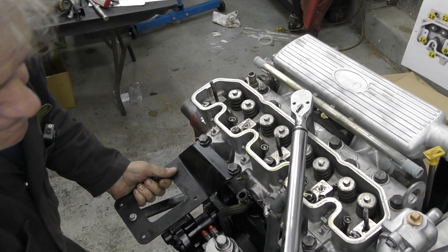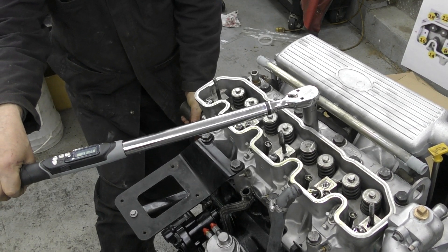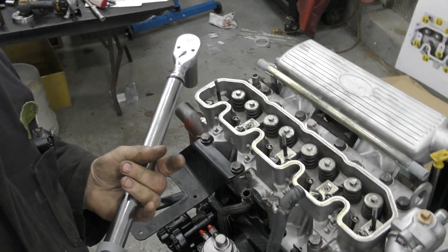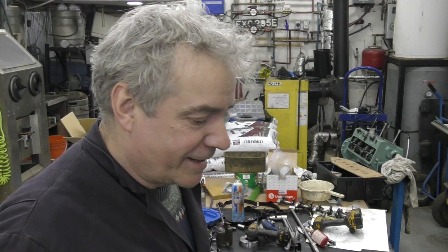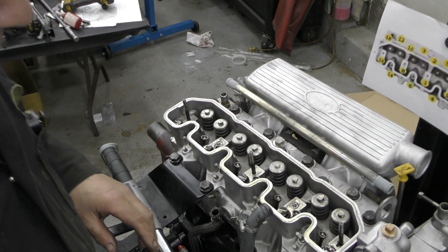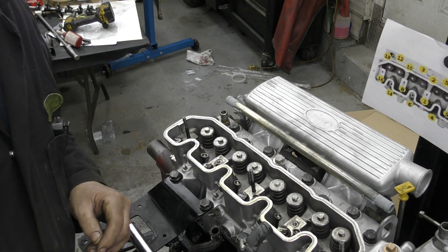Now I'm going to change the setting to 150 degrees. Ready? It's tight — it's very tight. They're not going to come off going over a bump with your cylinder head coming off. It is quite a job to turn it to 150 degrees, and when you're doing it 60-60-60-60-60 it's not so bad, but when you do it all in one go it's kind of hard. I'll finish these off and then we can come back and do something else. I'm really impressed with the little buzzer thing — you know when it changes colour. Right, less rambling, let's get on.